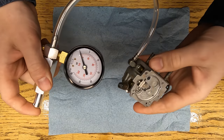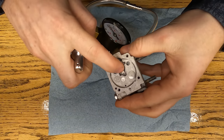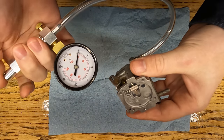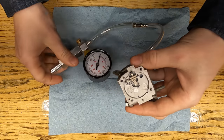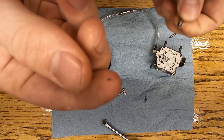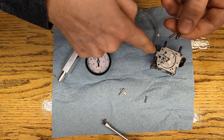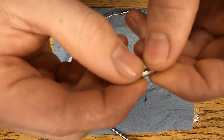What I have here is a little pump that pumps up the carburetor and basically tells you whether or not your metering valve is making a good seal against the bottom inside. Pumping this, I can't get any pressure. There's a little speck on here — a little metal shaving, you can see it on my finger now. Just that being down inside of that little hole is enough to not allow this thing to seat properly.